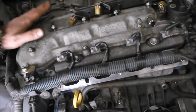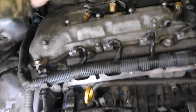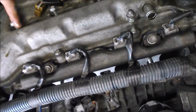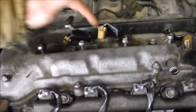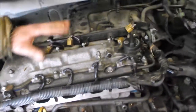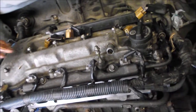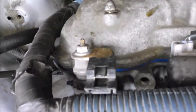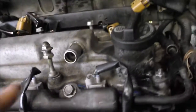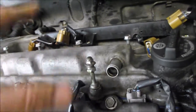The tensioner is in, and then we put the valve cover on with a new gasket. You don't need to replace it, but we chose to. This gasket has a perimeter gasket and also little rings that seal the coil chambers to the spark plugs — they always leak oil, especially the two middle ones. It comes in a kit so we did all new valve cover gaskets. You torque down all those bolts, and some of them have harness brackets on. There's also a cosmetic plastic cover — you torque the valve cover bolts but not the ones holding the plastic cover.